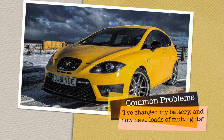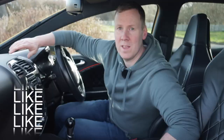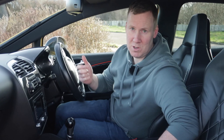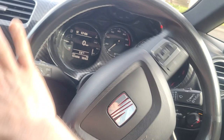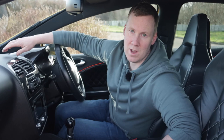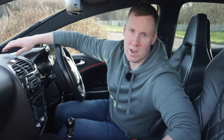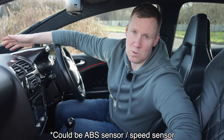So if you've had the battery go completely flat, or if you've had to get a new battery and you turn the ignition on and see a whole bunch of lights on the dashboard, this is pretty common for these cars and quite easy to fix. First of all, have the car running, get the steering wheel and go full lock left, full lock right, and do that a few times in both directions to see if that clears it. If that doesn't clear it, take the car for a short test drive — nothing crazy, just five or ten minutes — and that should clear most of the lights off the dashboard. If they are still there, there might be an underlying issue, in which case you should plug in diagnostic software and get it checked out properly.